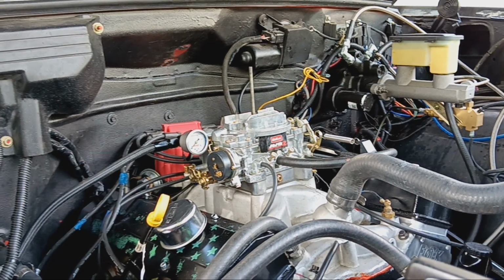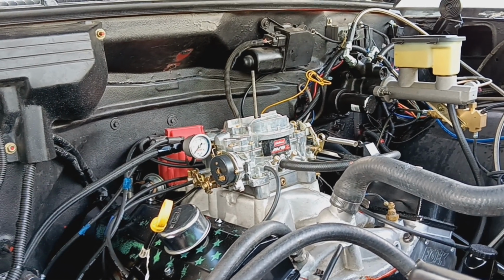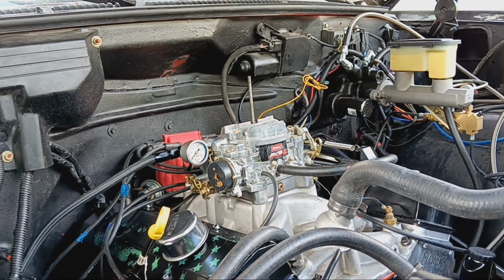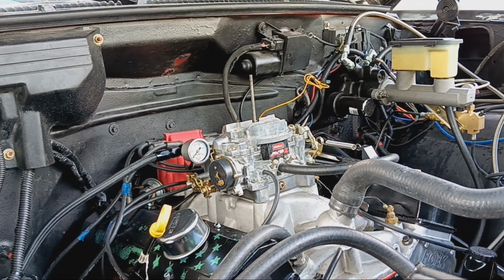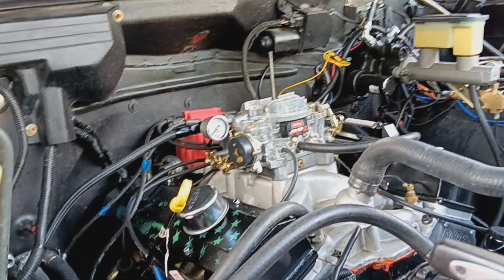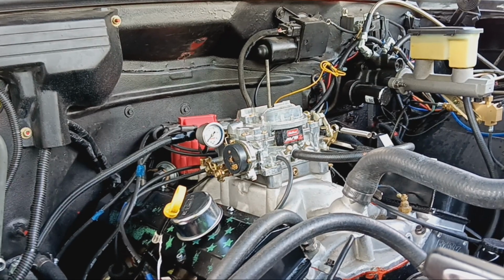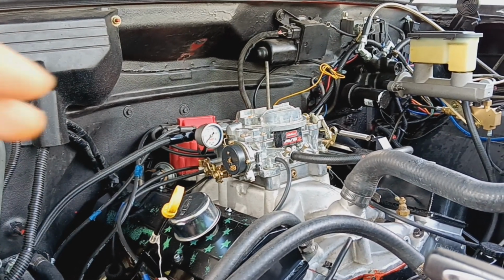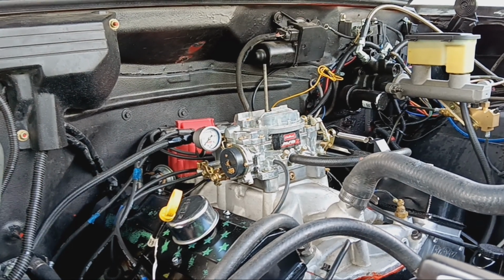So I'm like, well, I'm three quarters of a turn in now. A full turn to the nut, they claim, is 42,000ths. Divide it by four, it's 10.5. So what, 31.5 thousandths in. I just gave them another half a turn, put them up to what, 52, 53 thousandths. At that point, they're quiet. There's no noise out of them whatsoever.